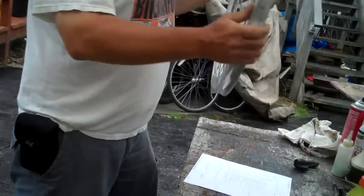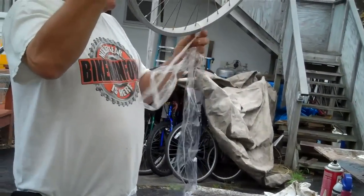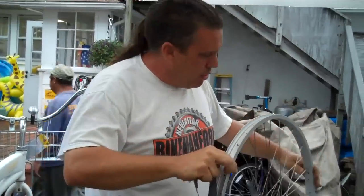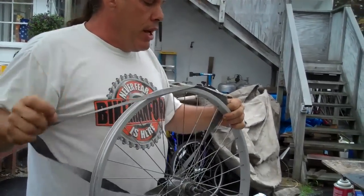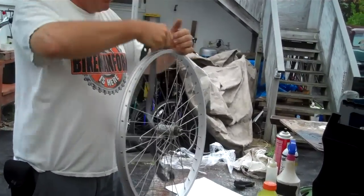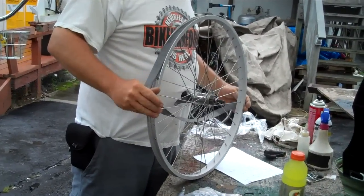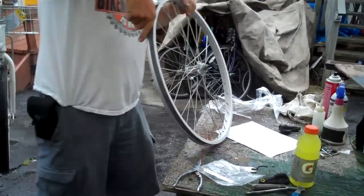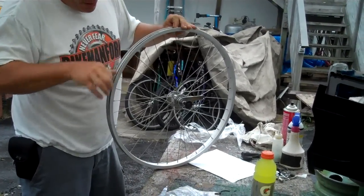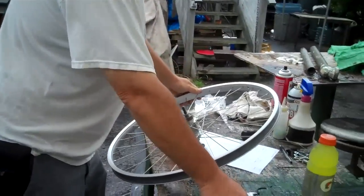So here you go. We have a nice brand new wheel. This is coming to you as you see it. We do take the plastic wrap off because, as usual, with all of the Bike Man's wheels, you get a brand new rubber rim strip, which I'm installing. If you need for me to install the cog, just give me a note and I will. I'm going to show you real quick here on what's going on with the cog after I get this rim strip on here. Line up the hole. Make sure you're covering all of those spoke nipples when you're doing this.